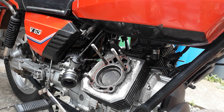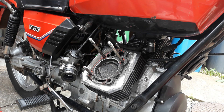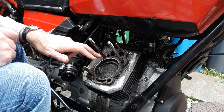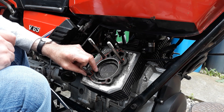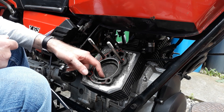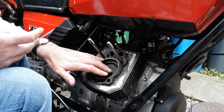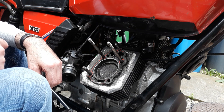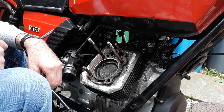In the fourth installment of the Moto Guzzi V65 engine investigation, I've removed the cylinder head, exposing the top of the right-hand piston. There was a lot of swarf — metal shavings — lying in the hollowed-out crown of the piston. I'm going to remove the cylinder barrel so we can have a better look at this piston, remove it, and properly examine it for damage to work out whether it could potentially be salvageable or not.